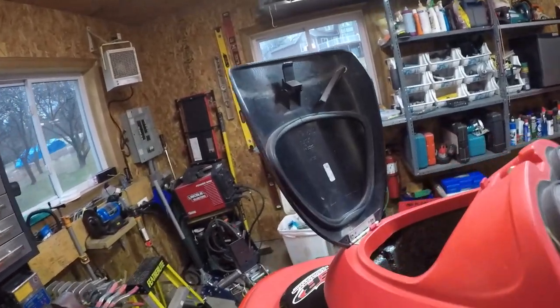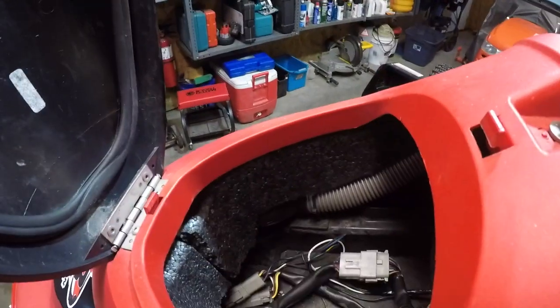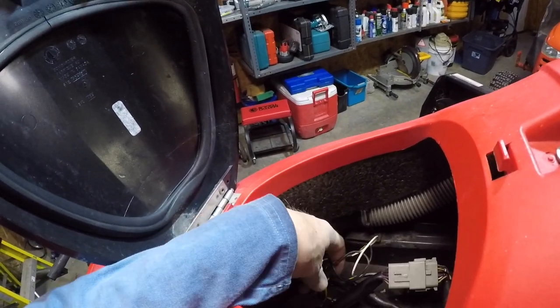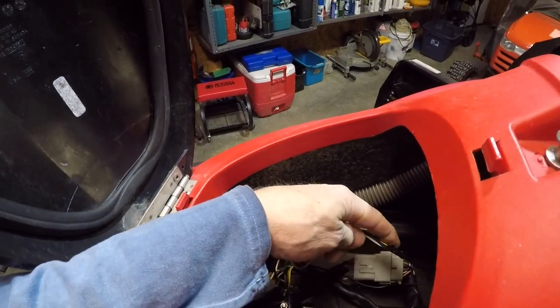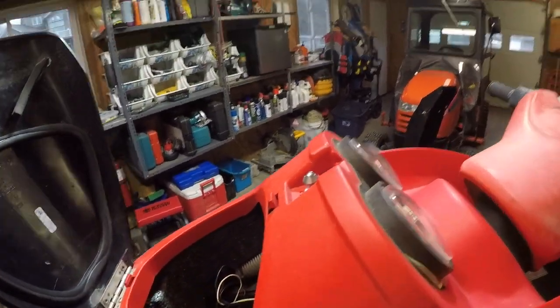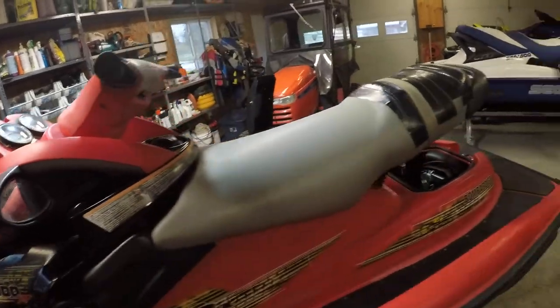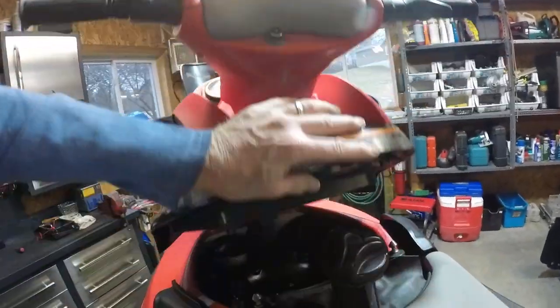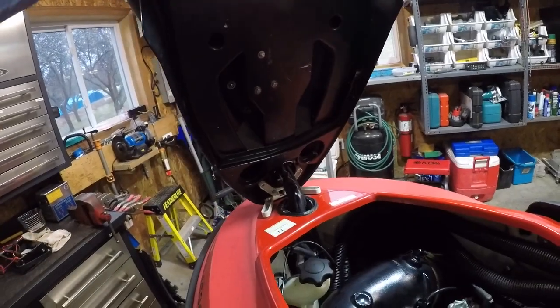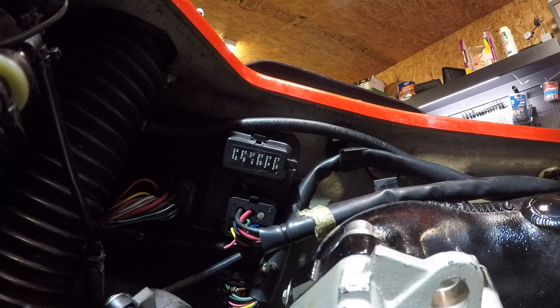Okay. So I think before I mess with this, these are the wires that were heat shrunk, and I see he's got tape all the way up. So we need to see what he did up inside there. But I think before that, we're going to do a fuse check. So let's do that. Get a good ground here.